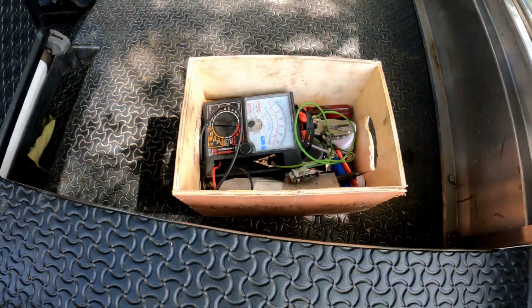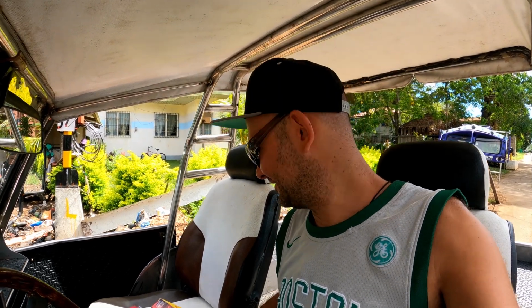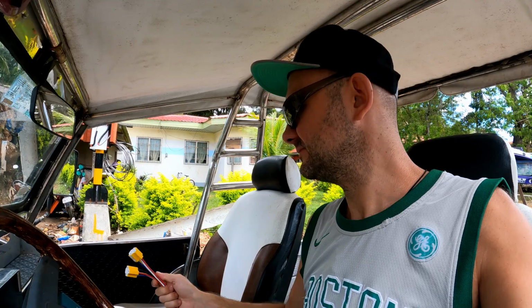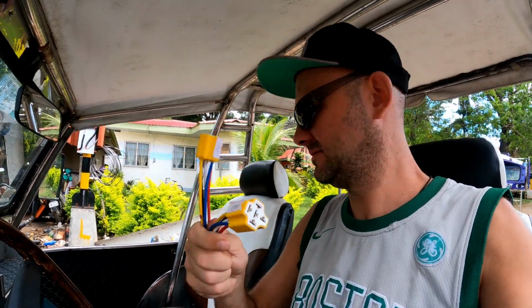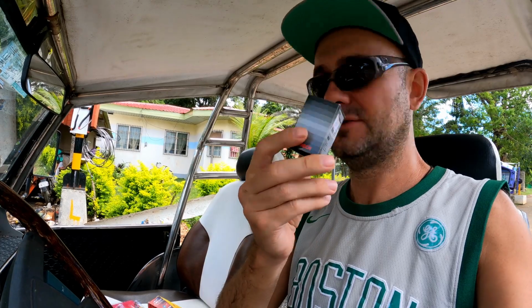Starship experienced some electrical issues with the lights, like front lights. Sometimes they work, sometimes not, and it's not so good. We need to go back home when it's dark. The problem is the electric relays, they are burned, a little melted already. And also new sockets. I have brand new. It's like $600 I paid for the new relays and the sockets.